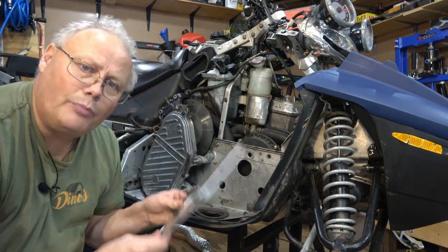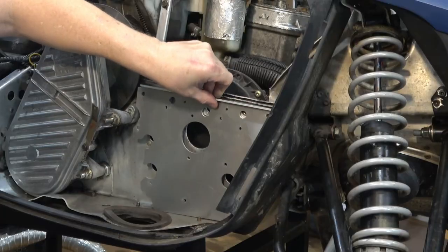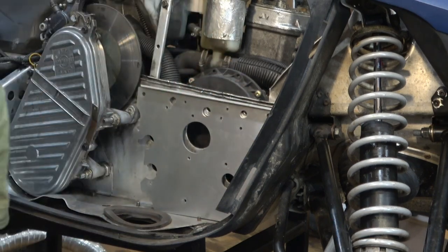This support plate, once you get this straightened, fits in like this and uses the factory holes to strengthen and reinforce the repair that you make to this area. All right, it's me from the future, and you can tell because of the fantastic haircut. I did want to take a bit of time right now just to stress the importance of getting that tunnel as straight as you can before you try to put the bracket on there.